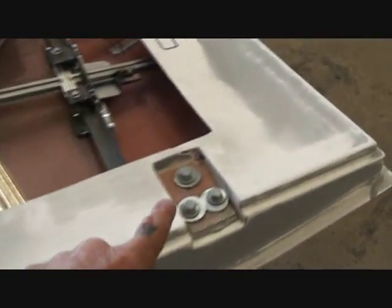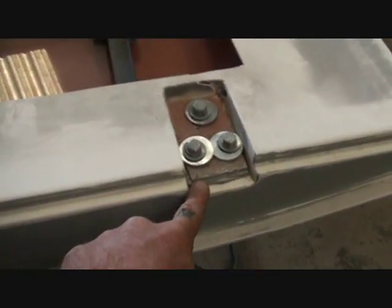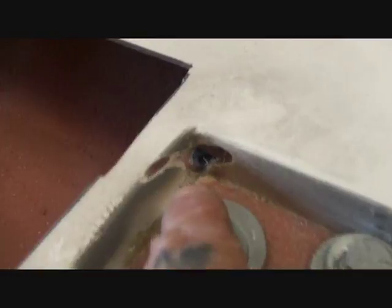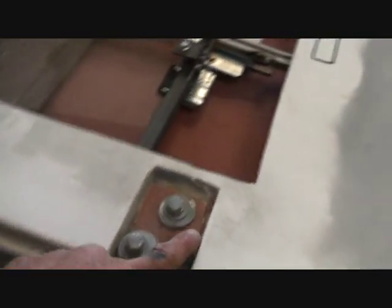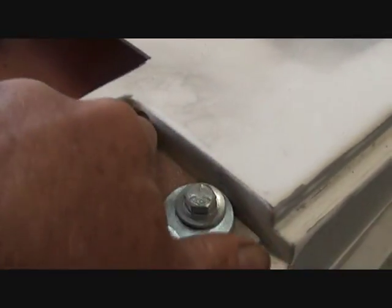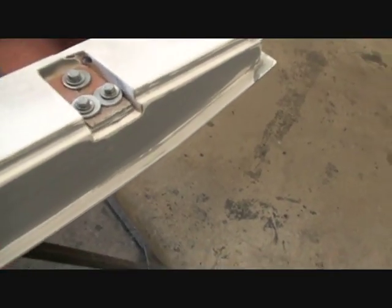Now on the lower hinge, after you have already hung your doors — your doors are hung, you've already got your fiberglass shims glued in and everything's in place — you want to take a half inch drill. If you look real close, there's the bottom of the door. On the bottom corner of your lower hinge, you want to go ahead and drill a hole at an angle going down into your car. Do not put your wires in this area here on your door jamb — when you shut your door, the wires are going to bind up.